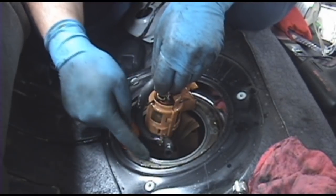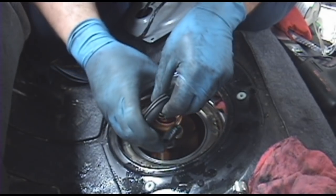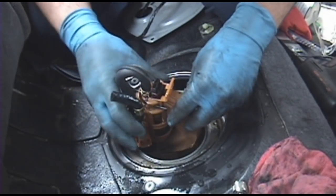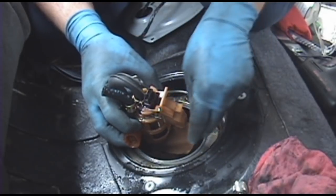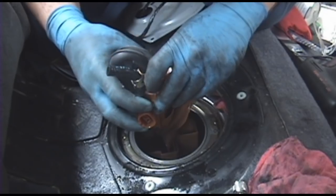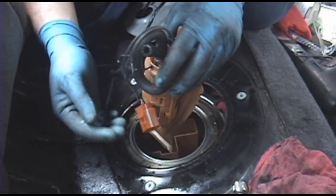and also I pulled out the O-ring that resides in here. So typically with Nissan O-rings for the fuel tank, sending unit assembly and all that, if they get fuel on them, they expand pretty good, and it will never seal this again. Which kind of sucks. You also want to make sure you don't damage it on reinstallation or by scratching it with anything.